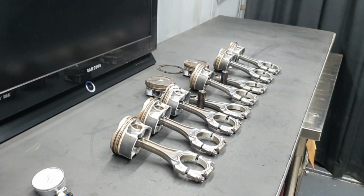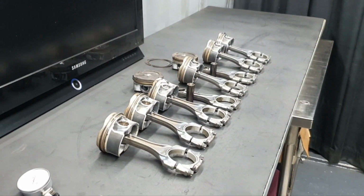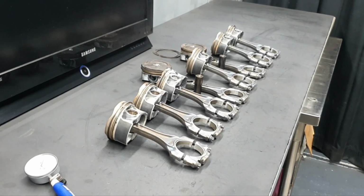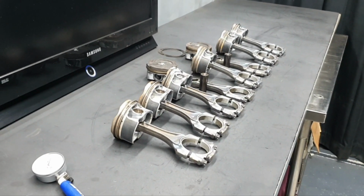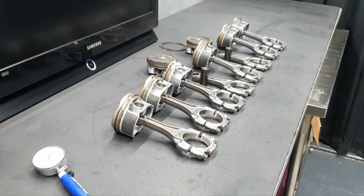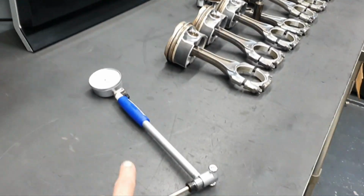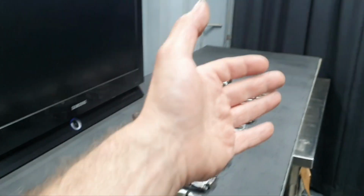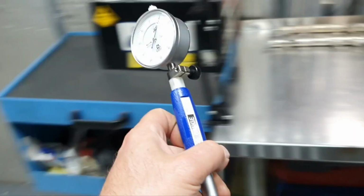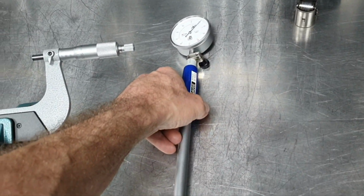If he wants me to strip off the crankshaft completely from the block, that's what I'm gonna do. If it was up to me, I'm gonna remove the crankshaft, strip off the block completely, and check it at the machine shop just to double check the bore size. For the number 3 cylinder, I don't know what I can do, or what the machine shop can do. I see some runout. I'm trusting this tool, because with it I'm measuring all the blocks. I don't have a reason not to trust it. I'm doing the same thing with all of them, same tools, same calibration.